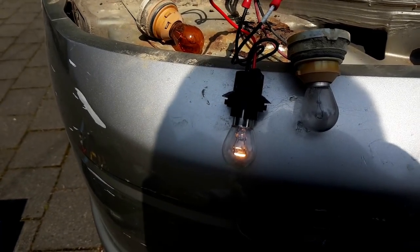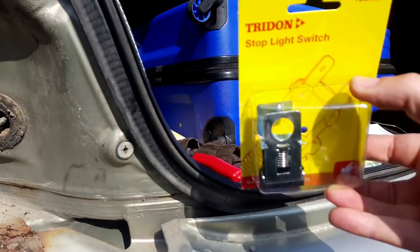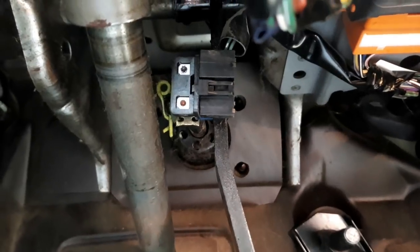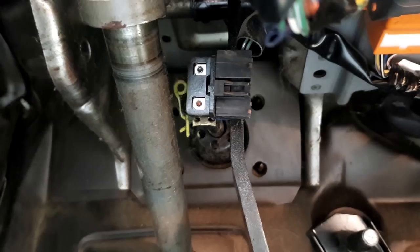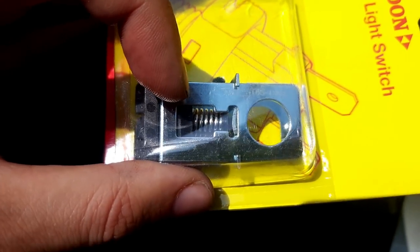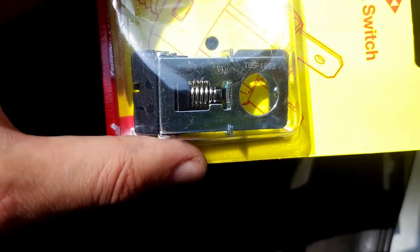Stage one is complete - we have a working tail light. I can't test the brake light yet because the brake light system isn't working. So I now need to fit this brake light switch arrangement. This is the Ford arrangement and the switch sits on the shaft that the pedal operates on. I think it's held in by a big R-clip and it doesn't work in a way I'd expect. There must be a cam or something that operates and pushes that slider along. All a bit peculiar.